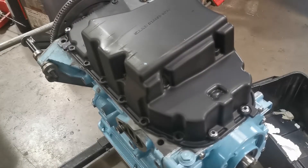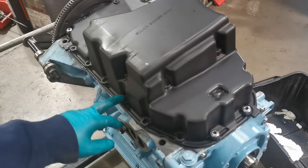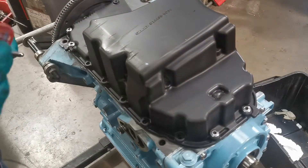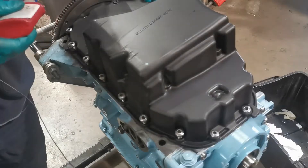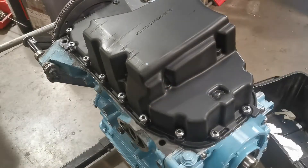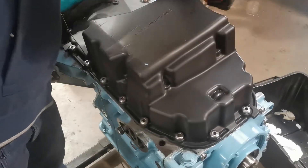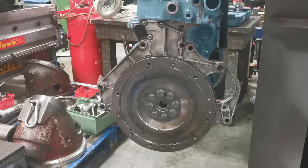After putting the timing cover plate on and the flywheel, I mustn't forget to put the bolts in underneath here. I can torque them up now to 22Nm. I've torqued the oil sump bolts up as well, washed them, and locked them in — so we should be done. I think that's as far as I'm going to take it today in terms of the build. Thanks for watching — comment and subscribe.